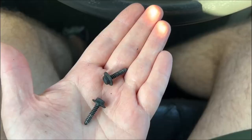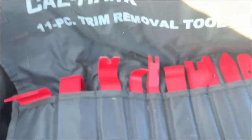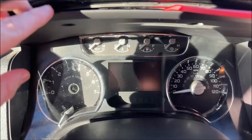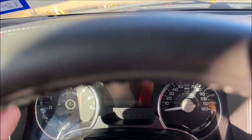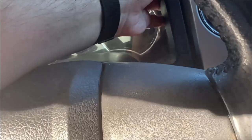Got those out, and I'm going to go to the trim removal kit and start trying to work my way in between there and all the way down to pull out the sides. This is about what it looks like — got a couple of options here. I'll be able to get underneath there; there are a couple of clips you just have to watch out for. Got that top. Now I'm going to work on the sides — I was able to pull that out pretty easily. Let's see if the side is the same. Alright, that's out.